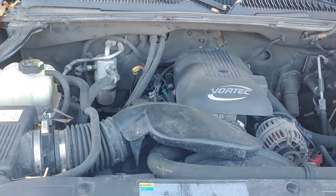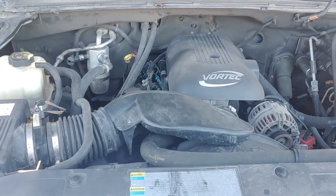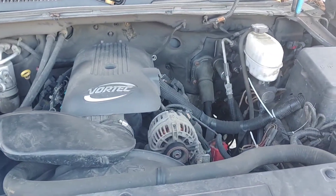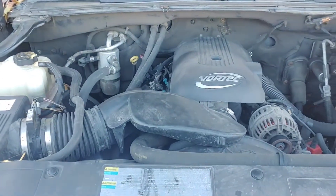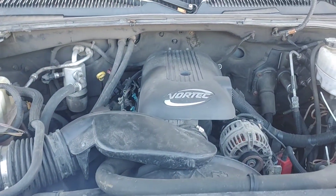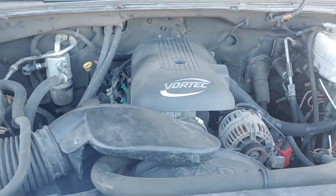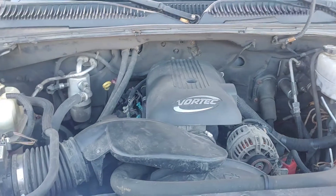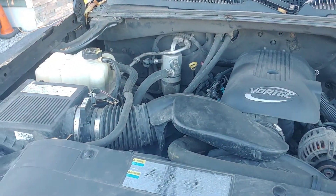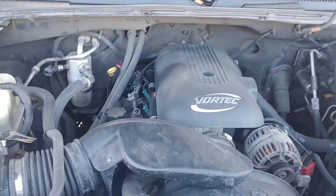After you've made sure everything was dry, open up your hood. You're going to check your oil, your transmission fluid, your power steering fluid, your coolant, your brake fluid, your washer fluid, and if you've got a stick shift, your clutch fluid. You want to make sure everything's all topped off and good before you start checking on anything else.